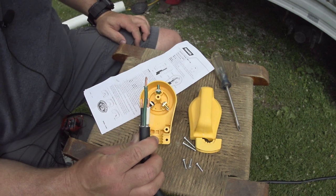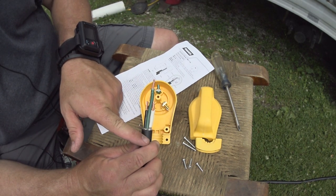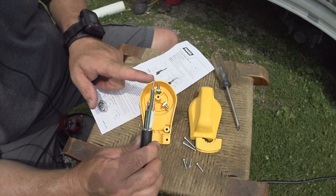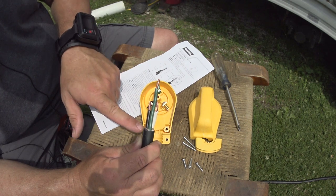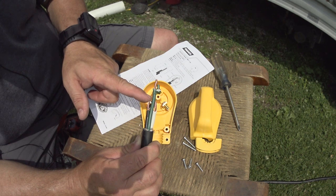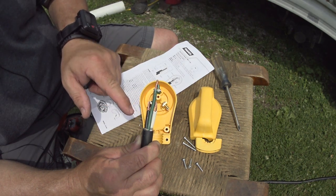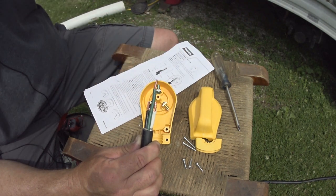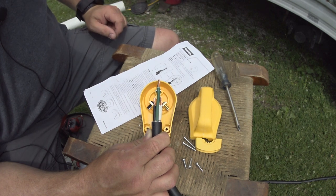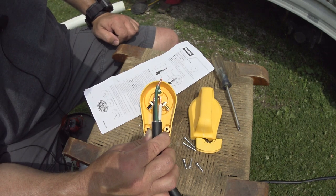All right, so we've got all our wires trimmed back. What you've got is 3 inches from where the black stops on the sheathing for the entire cord to the tip of this one. Then you cut it back a half an inch. And then on these, from the black sheathing to the tip is 1¾ inches on both of these. And then of course a half inch sheared back to show the wiring there. And as far as placement, it looks like these cables are going to have plenty of room to go around and hook into the connectors where they need to be.